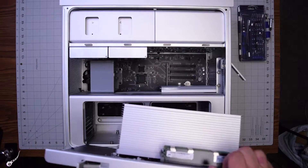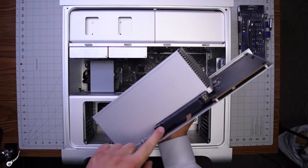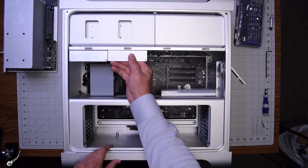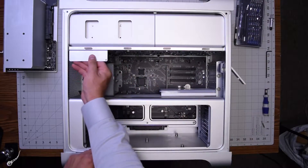This model has two latches that you can push out and pull out the tray that holds the CPU and the memory. Some models have two CPUs so you will see two heat sinks. Next, go ahead and pull out the hard drive trays — they just come right out when you pull them off the rails.